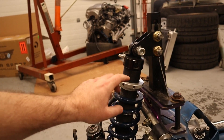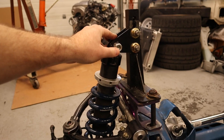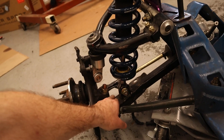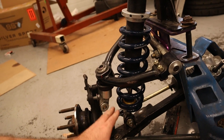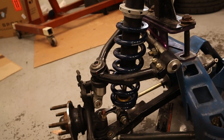That is one reason I actually had to make this new bracket — this isn't my original design for how I attach the upper coilover. And for the rear placement, you want to be as close to the ball joint as possible to help with your motion ratio, but as I go closer to that, I start getting interference with the upper control arm and things of that nature.